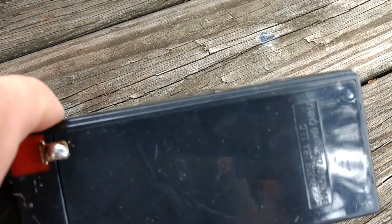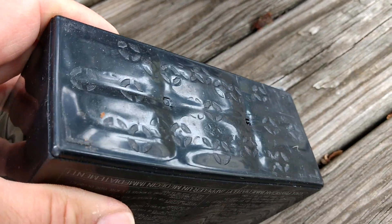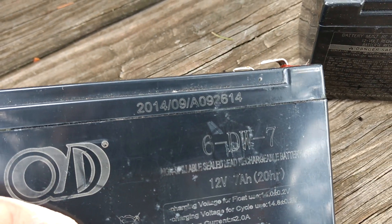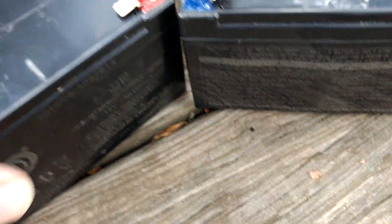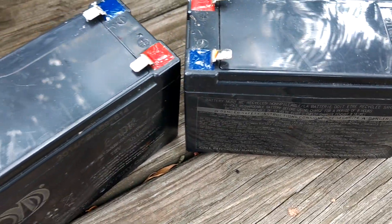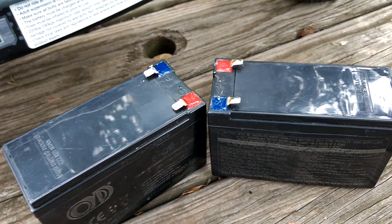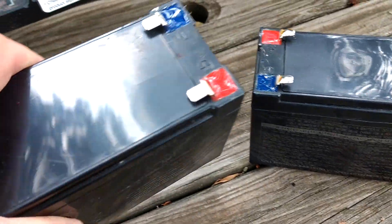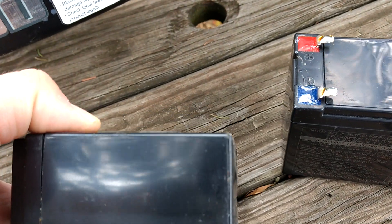You can see more bubbling on this one on the side and on the bottom. There's a date code on these batteries: 2014-09, so it's September 2014. It's now 2019, so it's been five years. This scooter really hasn't worked much in the last two years — just from sitting, not being properly charged, and not being used, the batteries went bad. Not really sure why they're puffing out; must be some chemical reaction happening inside making the material expand.